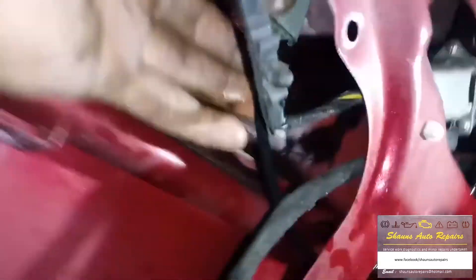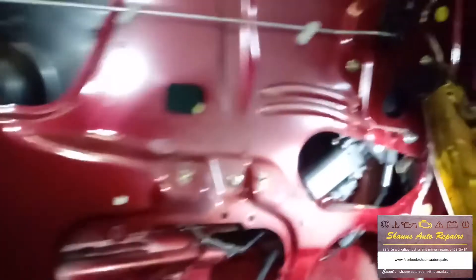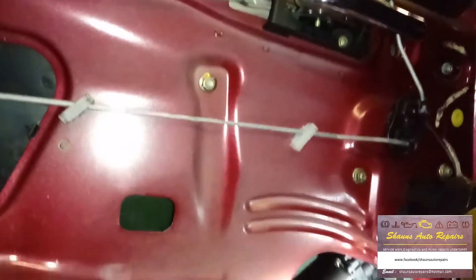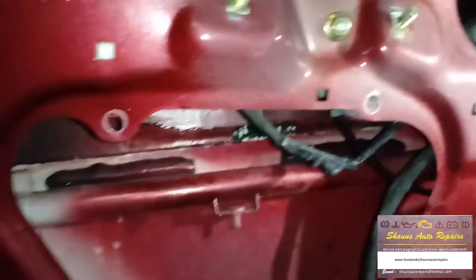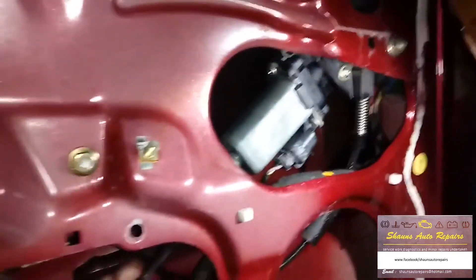Right at the top, where that yellow clip is, that's where the window bolts onto the channel. In here it was seized up, so with a lot of penetrating fluid and working it backwards and forwards it's now going - working lovely. What tends to happen is the cables corrode or lose their tension, and when the springs don't take up the slack anymore they come off the pulleys and it all comes unwound, which is not ideal. I think that's sorted - we'll box it back together and give it a final test.